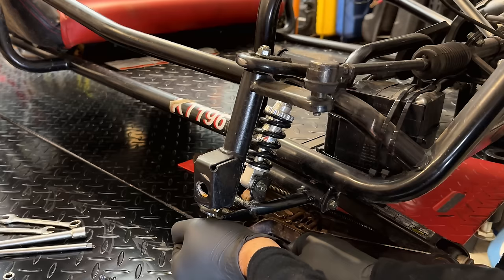And we're in. It wasn't that bad, actually, either. I was imagining it to be a lot worse. And now that this cover's off, I can actually see this is going to be a lot easier than I thought. Initially, I had assumed we'd have to pull off this jack shaft, pull both chains, the one that's up here, and there's another one down there, and I thought we'd have to pull this engine mount off as well, but I don't think that's the case. We just need to remove this pulley, and a couple bolts under this bracket hold the engine in. So once those bolts are out, this thing should come right out of here.